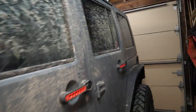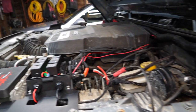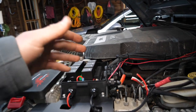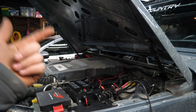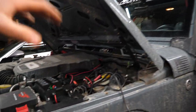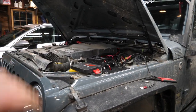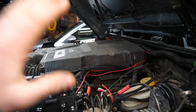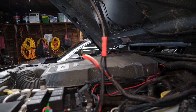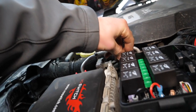I've buttoned up the interior looking nice and neat with our wire hanging out in the middle. One thing that was a little annoying converting from the original to the new is that we don't have a ground inside this box, but that's actually going to help things out — it's more economical for Voswitch and for us because we don't have to run negative wires from far-away accessories all the way to this box; we only have to run the positive wire now. For my four accessories that already had grounds running to this location, I consolidated those four onto one ring connector.